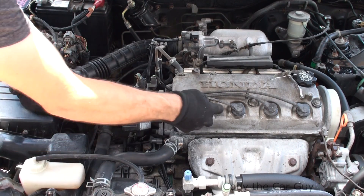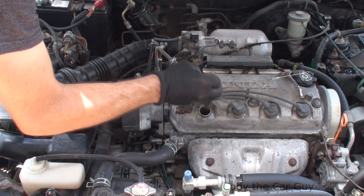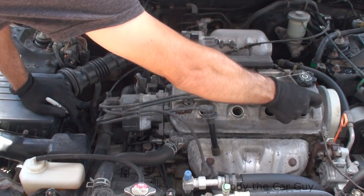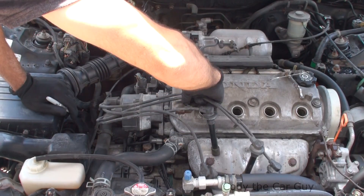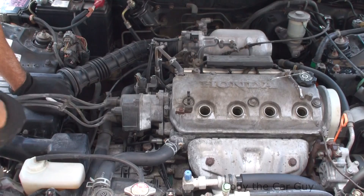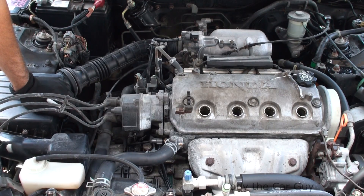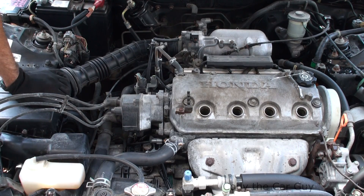Then at that point, go ahead and unplug all your plug wires and get them out, and we're going to pull that back and replace the O-ring. These are outside — three 12mm, one right here, one right here, one right here — and we'll go ahead and get this out. Pretty simple and easy fix, but that O-ring when it's bad can make a big mess. You'll start dripping oil everywhere, so let's go ahead and get this out.